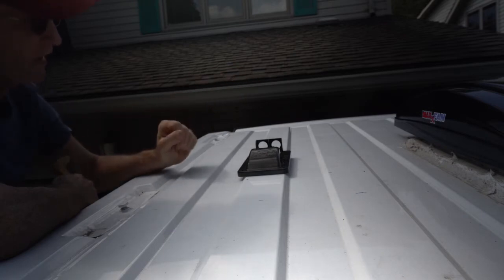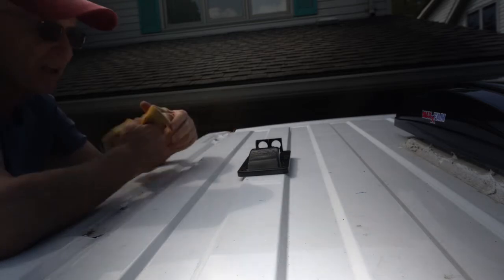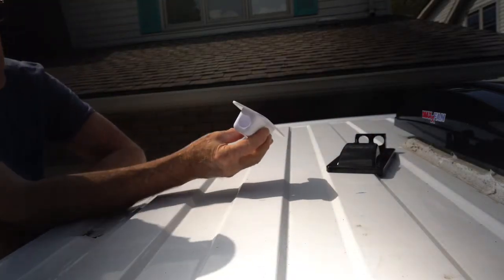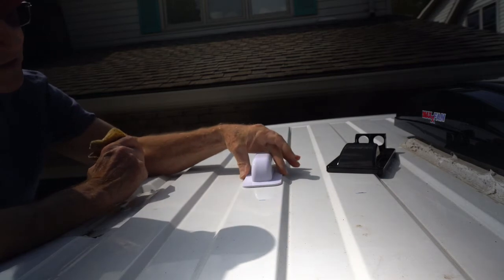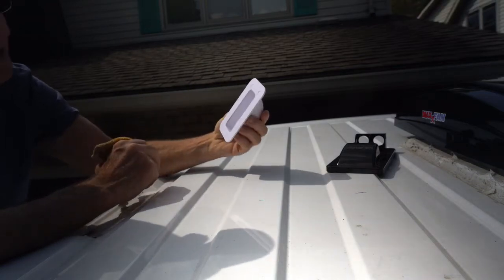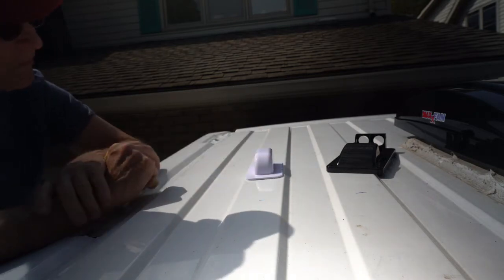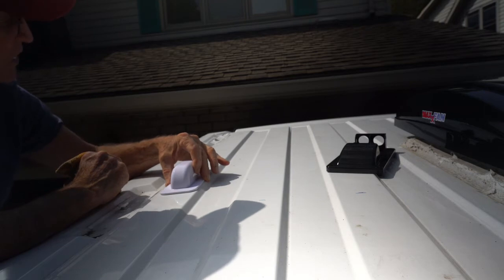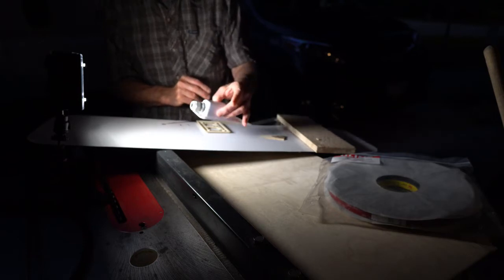My other option would be to go through the back of the van through the box that sits at the back that houses the backup camera. Or I sourced this box — this is a single cable entry box — and I'll use two of them, one for the positive and one for the negative. You can see it fits very nicely on the ridge of the ProMaster. I'm going to use some 3M double-sided industrial tape to secure that box on top of the ridge, with two boxes — one in this location and one along the other edge of the ridge.